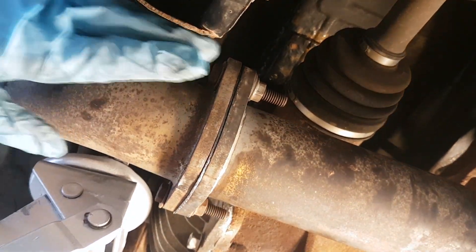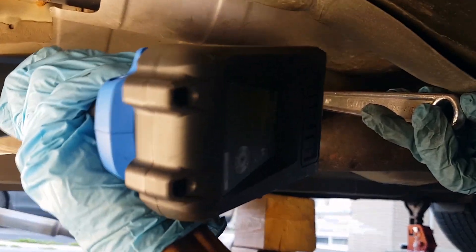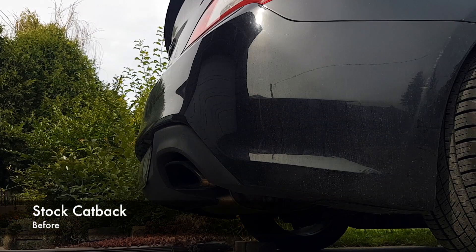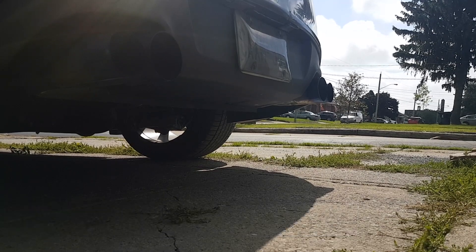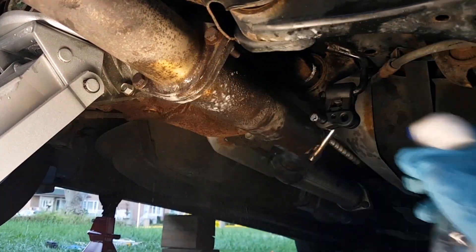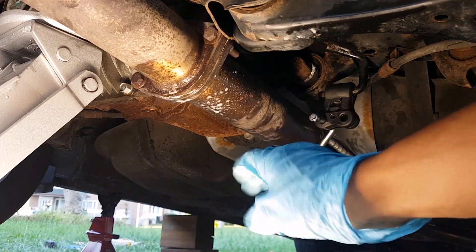The mid pipe and the down pipe are completely sealed. Put a wrench on like this to fully tighten. That's completely sealed. Now we can start up the car. That's all you gotta do — spray soapy water here and look for bubbles. If there are any bubbles foaming around, that's an exhaust leak. Right here there's nothing, so we're good.